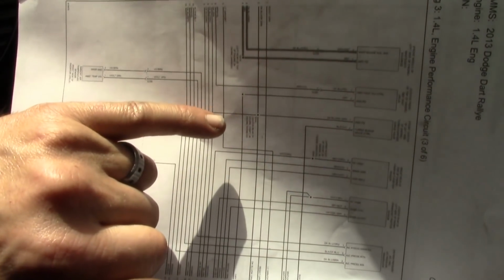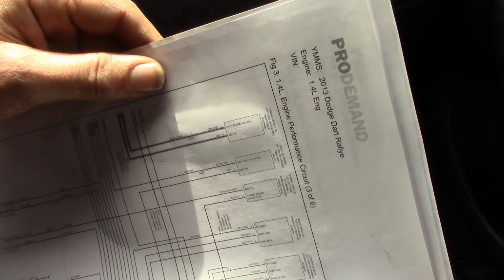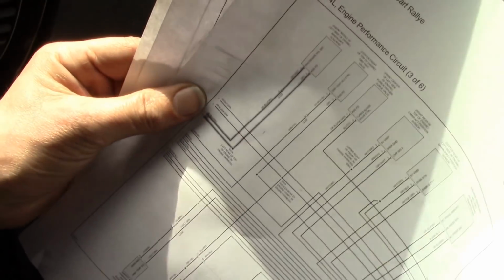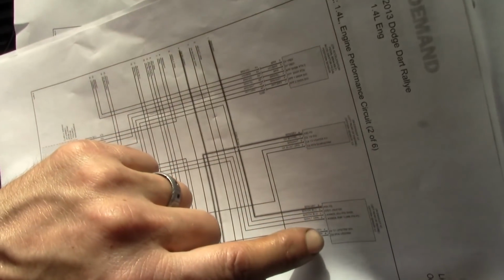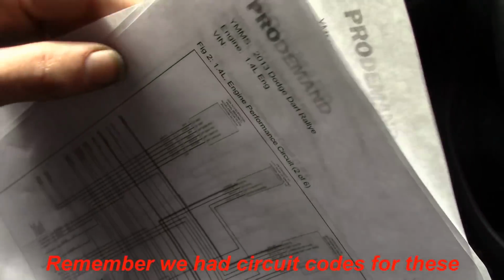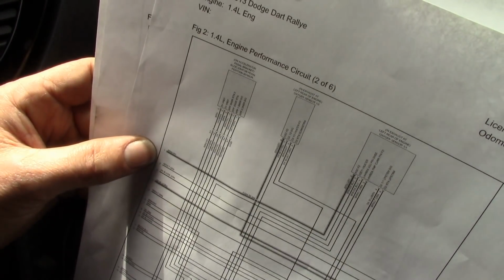These are all connected. So this goes to, I'm having a OBD2 vent valve, turbocharger surge valve. Oh, wait a second. No, I'm sorry. Deep 6, that one. It doesn't go to that. It goes to this. And it goes across, which I don't have the rest of that, which we don't need. But we're going to look here, gray. And this continues and goes to oxygen sensor, bank 1, sensor 2. What do you know? It also goes to oxygen sensor, bank 1, sensor 1. Wow. Already we have something in common here, don't we? We have a feed that is common.